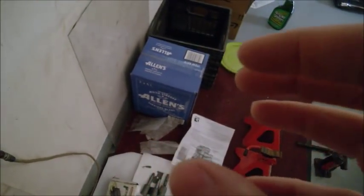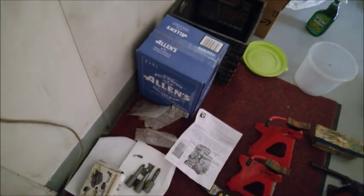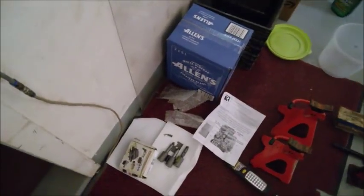2001, 2002, you might also have an issue with the valve body most of the time. But 2003 and up, it's mainly these three solenoids. That's because we don't replace the fluid every maybe 50,000 miles or so, and they get stuck, they get clogged.